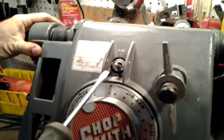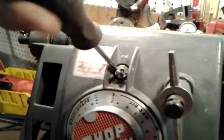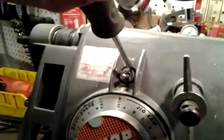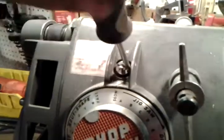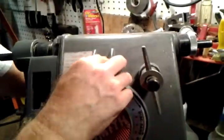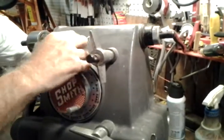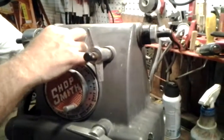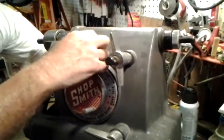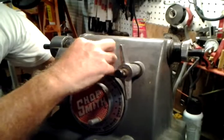This is how the normal switch looks. We've got this large nut on the outside. Make sure your machine is unplugged. You can just undo this big nut this way. Once it's kind of loose, you can finish by hand. I'm reaching inside the machine, so again, make sure your machine is unplugged for safety. I'm just stabilizing the back of the switch right now.